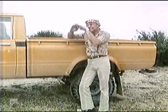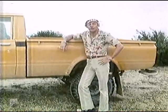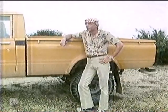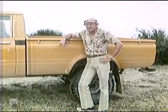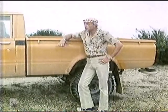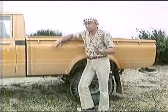That is, the springs aren't allowed to travel very far before they hit the bump stop rubbers, and then there's no suspension at all, at which point, of course, it kicks the vehicle, which it's doing all the time on these rough roads. It also has very skinny little shock absorbers, not off-road shock absorbers at all. That's something they could certainly improve. And if they do, it will probably be a very good off-road vehicle, but it's not yet.